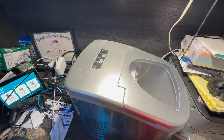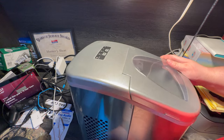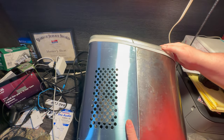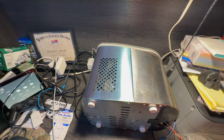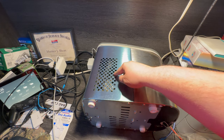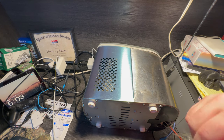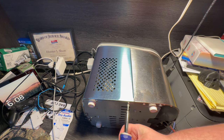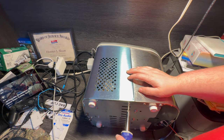So I've figured out how this needs to come apart. I just watched a video and we've got to flip it over. But I don't want to flip it all the way over because you want to be careful with these — there is a refrigeration compressor inside and you want to be mindful of the oil inside.